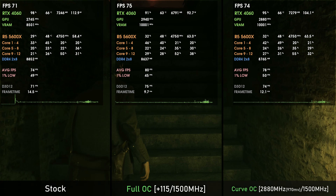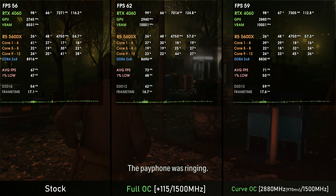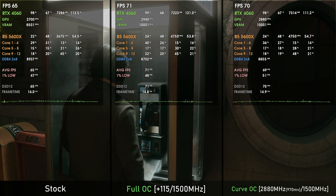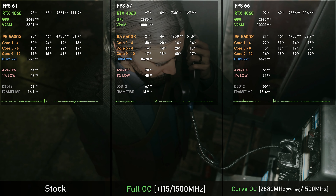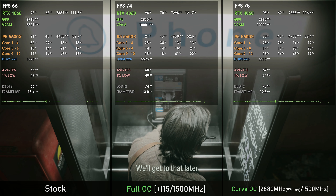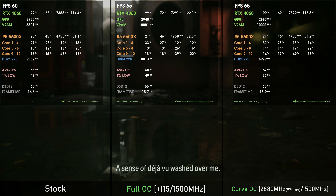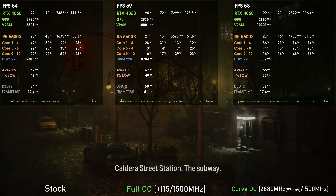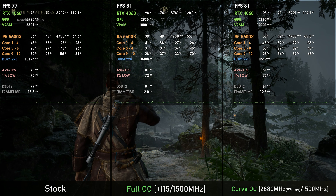The third and final question is: will this reduce my GPU's lifespan? The same answer applies. We are actually overclocking and undervolting at the same time — increasing frequencies while decreasing voltage. This can actually increase the GPU's lifespan, because reducing voltages will most likely reduce power draw and heat output. Less heat, lower power draw, lower voltages — that will usually increase the GPU's lifespan, not reduce it.